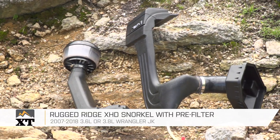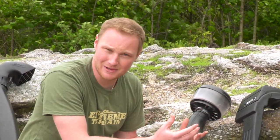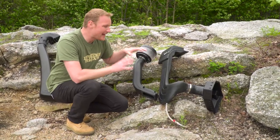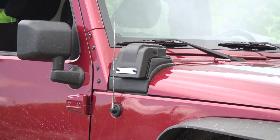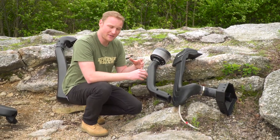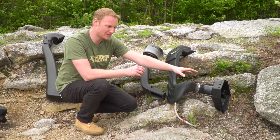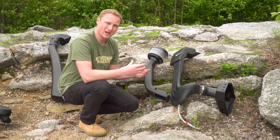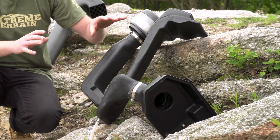The final option is actually the one I like the best — the Rugged Ridge XHD Snorkel. The reason I like this the best is I hate drilling big holes in the side of my Jeep or cutting big holes anywhere that you can't hide at a later date. I always like the option to go back to a factory style, and that's what this gives you. This requires a little bit of cutting, but you actually do it underneath the panel that you remove from the cowl, so if you ever take the snorkel off, you can go back to factory. This also doesn't require you to modify your factory airbox — it actually changes out the bottom half of the factory airbox with a replacement piece. So no major modifications, and you can go back to essentially a stock look with just a small cut that gets hidden by a body panel.